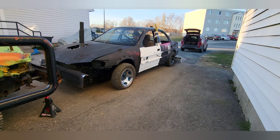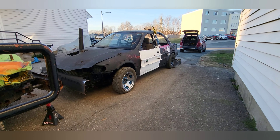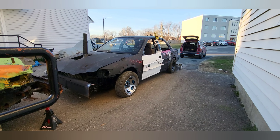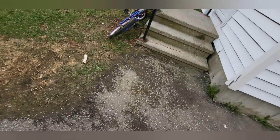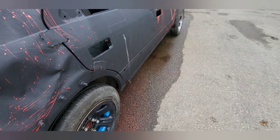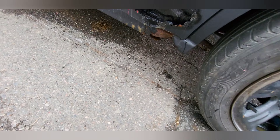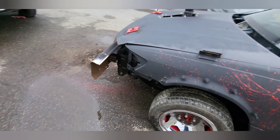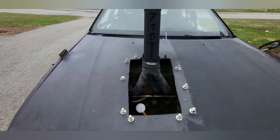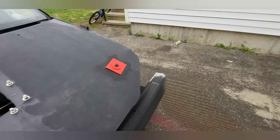She is definitely dragging something. That tire - I can see the scuffs. Just this one, you can see all the scuff marks. I'm probably gonna have to remove the rear brakes off of that side. There's probably a lot of water in that heat wrap making everything steam.